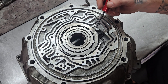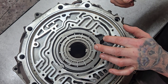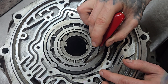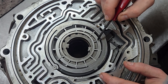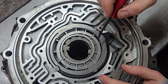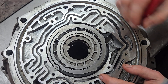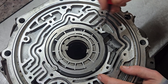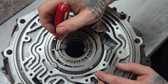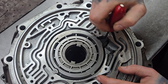Fun little fact I wanted to share: notice the position of these vanes. Right now they're primarily equalized, but when the whole thing is offset you'll notice this one is slightly more in than this one, and vice versa. The reason — and I just learned this — is to prevent fluid harmonics at a certain RPM, which could cause vibration. Hydraulic oil itself is noisy and we have a lot of stuff moving and making contact, so these vanes are spaced almost randomly at different points to prevent excessive harmonics.